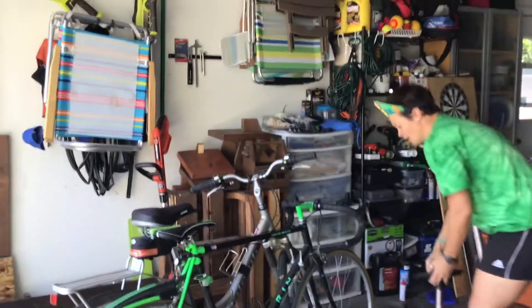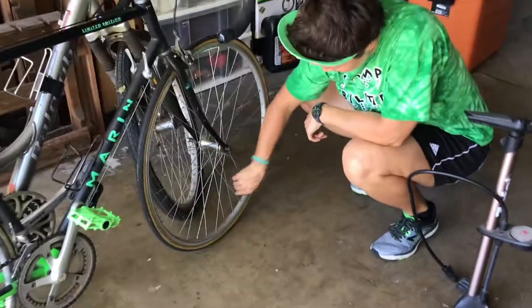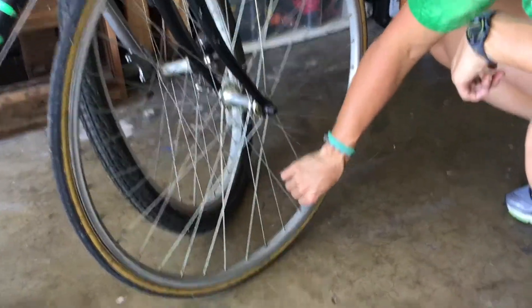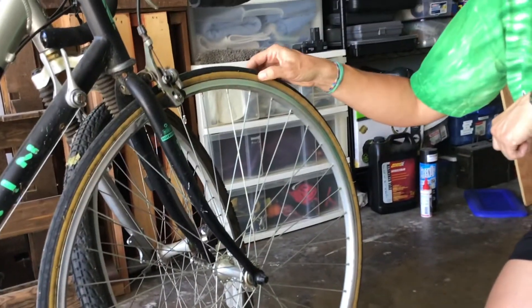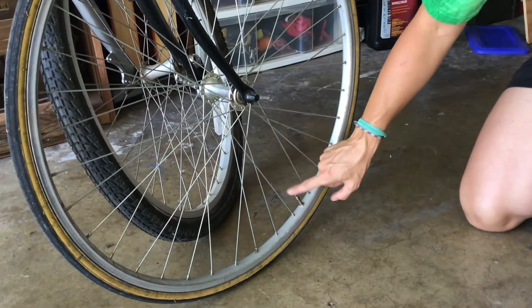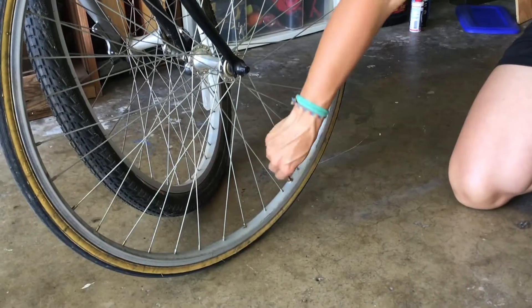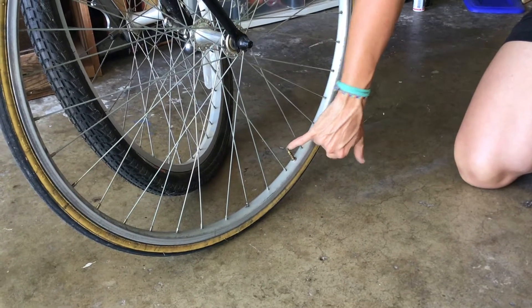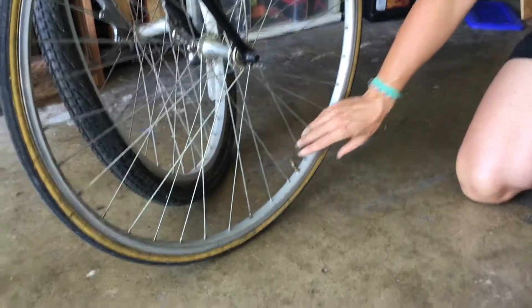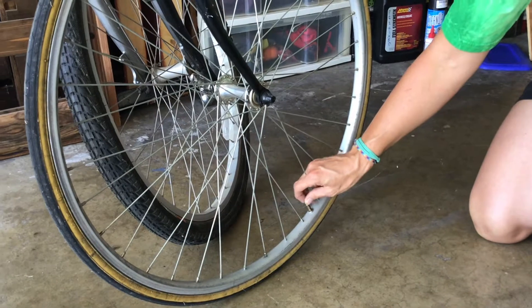Let's head over to the bike. I have two different bike examples. This one here is my Presta — you can see the black cap on here. I'd have to take the cap off to access the tube. The pin here means I can never pump it unless I've released it, because this locking mechanism really locks it in. I'd have to screw that little nut up to the top to release the pin, which then allows me to pump that tire. Most of you probably have a Schrader.